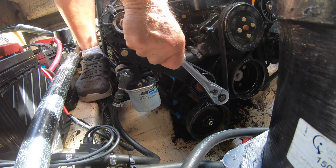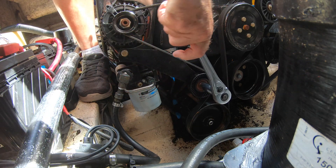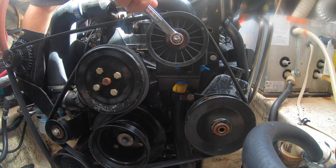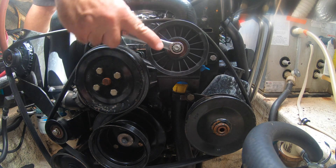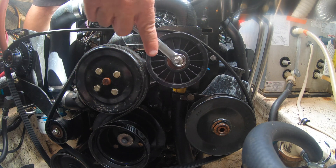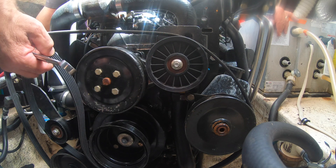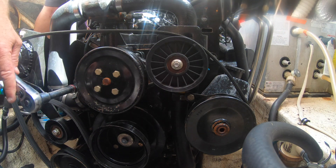My wife pointed out that I had trouble working on the engine because I did not have on my New Balance 608s. I had never done this repair before, so after figuring out that the idler pulley was not the one to remove, I found the tensioning pulley and took the tension off the serpentine belt so that could be removed. The easiest way to slide the belt off is off of the pulley on the recirculating pump — it doesn't have any ridges on it — and it's also the easiest way to put it back on.